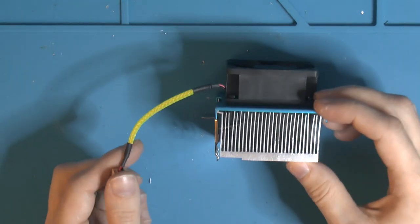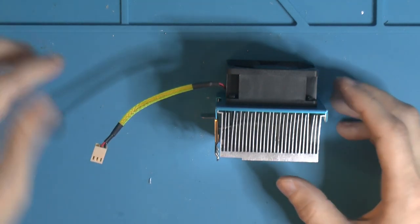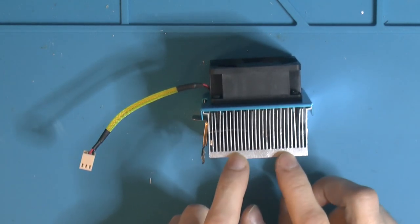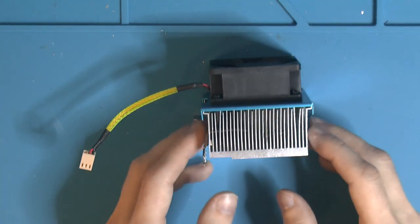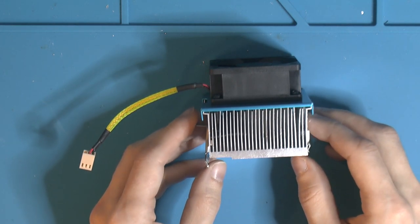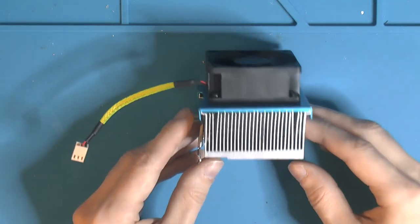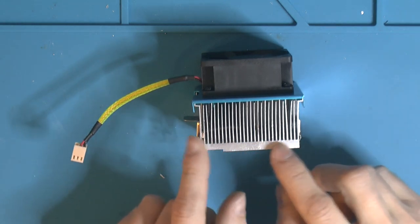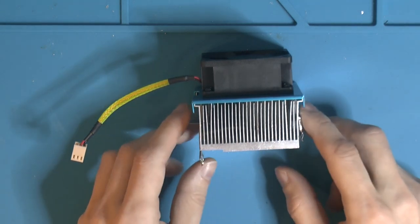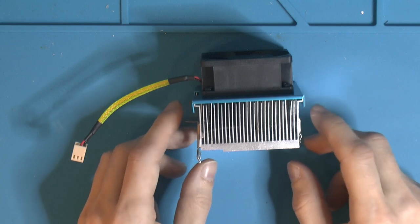It's a pretty beefy cooler for Super Socket 7, but if you want to run fully stable at those frequencies, you've got to get the temperatures down. When I had the old fan, the base here was about six to eight degrees above ambient — so it's not ice cold. It actually gets a little bit warmer than one would think even with a 16 to 19 watt TDP CPU, even overclocked. That kind of lines up with what this cooler is intended for — with an Athlon Thunderbird this base would be like 40°C above ambient at 72 watts.